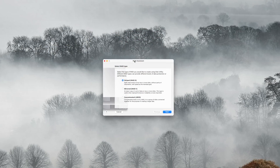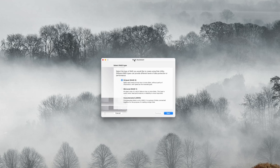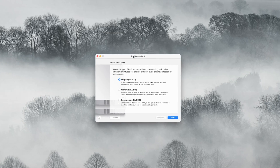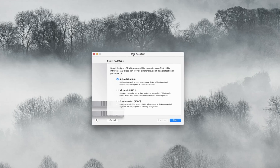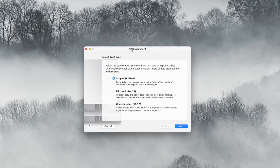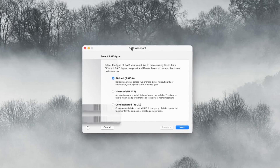I'm fully aware of OpenZFS for macOS, and maybe that's for another video. But built into the operating system, there are only three different options for a software RAID: RAID 0, which stripes data across all discs without redundancy; RAID 1, which mirrors data across all the discs; and a good old-fashioned JBOD, which basically just adds all the discs together into one giant disc, again without any redundancy. No RAID 5, RAID 10, or anything else — which is a real bummer. That said, we can still test the performance of these options to see how well the D4 SSD performs overall.